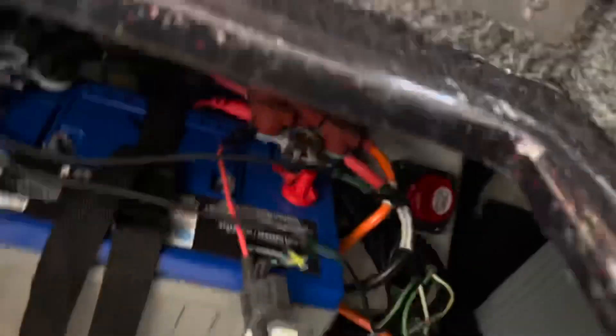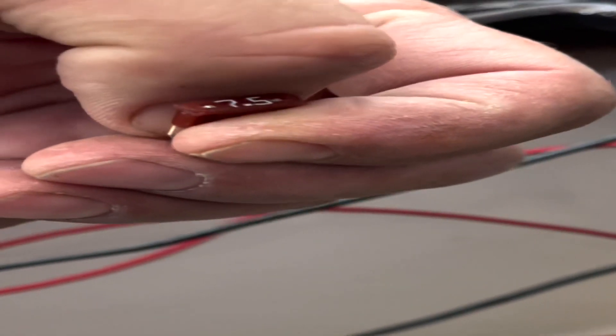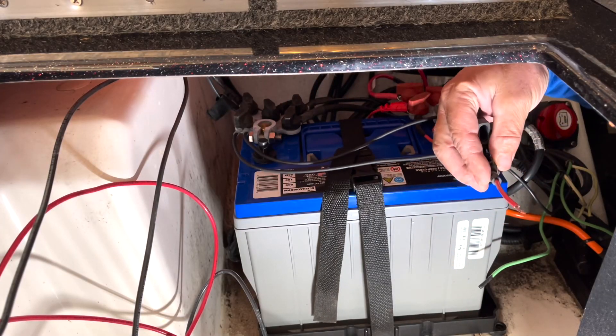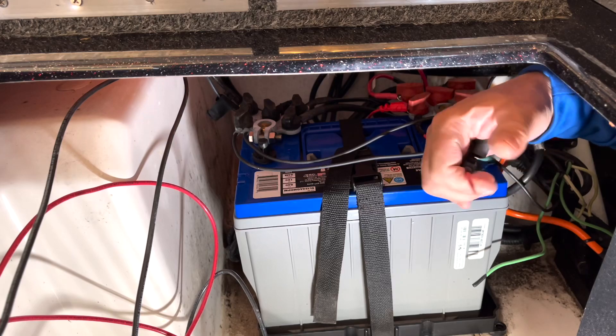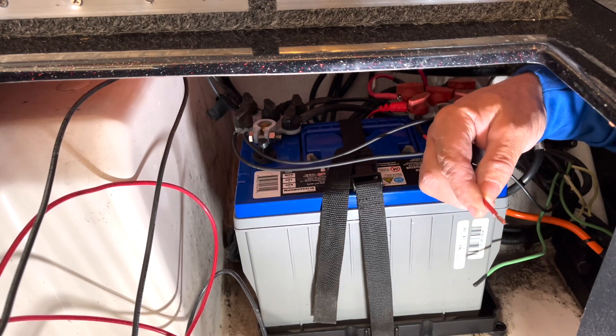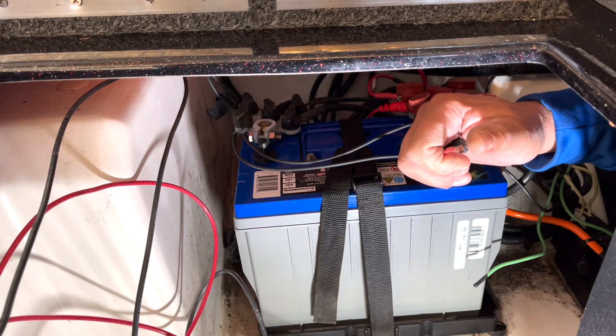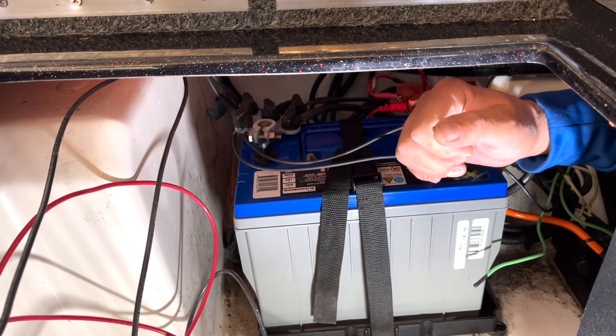We've got our fuse right here — this is going to be our first stop, a seven-and-a-half amp fuse. The first thing we're going to want to do is unhook our wires from all these posts, make it safe, go to the front end, tie our new wire onto one of those wires, and then pull them all through to the back. This is safe to work on — the hot has been neutralized by removal of the fuse. This is our hot; we're going to retain this and crimp our connector to it from the hot going to the back.